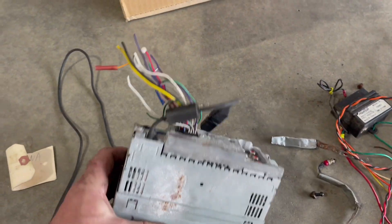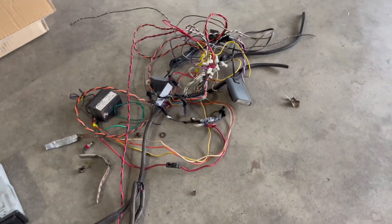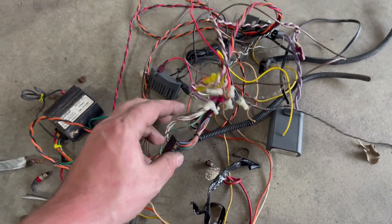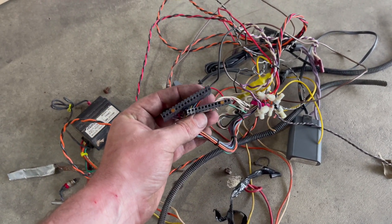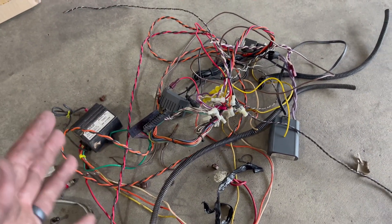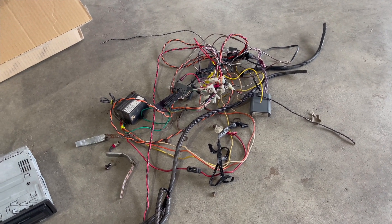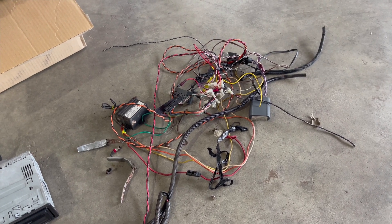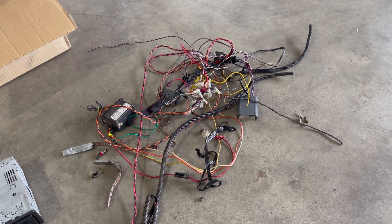While I was in there, I also ended up removing the stereo — I just cut off the pigtail so we can maybe use that on a different project somewhere down the road. All the rest of this wiring is for that alarm system. One of the other concerning parts was that the module is missing. So because this was wired in between ignition and there's no module, it may never complete the circuit, because the modules just aren't even there, let alone whether they're even working or not. So having this all removed, I know none of this can be a problem anymore. I still don't know whether that's part of why this car wouldn't start — maybe the owner who had it for that one year couldn't ever get the fob, possibly tried to start it or get it running, and couldn't figure it out. I'm all speculation at this point, but having this all removed is a huge point in the right direction.